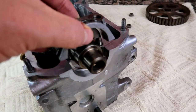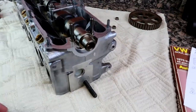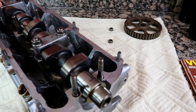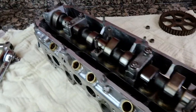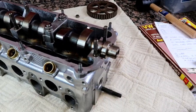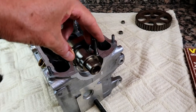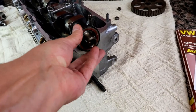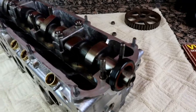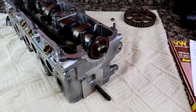These are loosened a bit but there's still positive upward pressure from the valve springs. By all tokens, I don't think I really need to move this up — taking the top cap off was enough to get enough space to get a new seal pressed in there. So let's do that next.